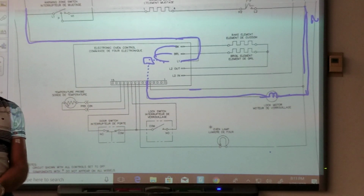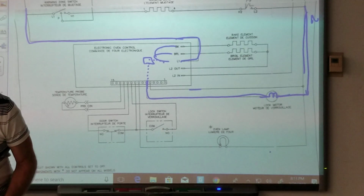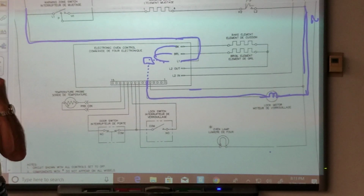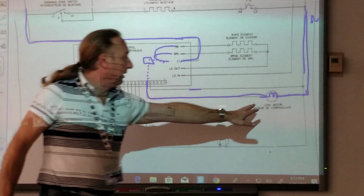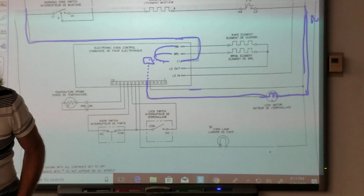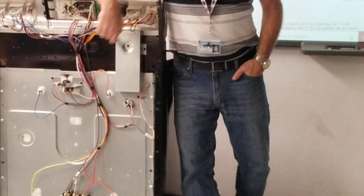Alright? Now we went and pressed clean. Did you guys see if this black part was rotating? Didn't. It wasn't rotating. Okay, so this motor wasn't rotating. Now before I go through testing the component out, remember I said we have a switch over here next to the motor.